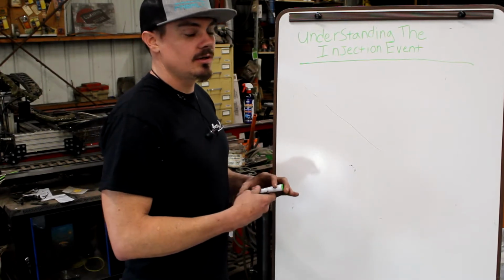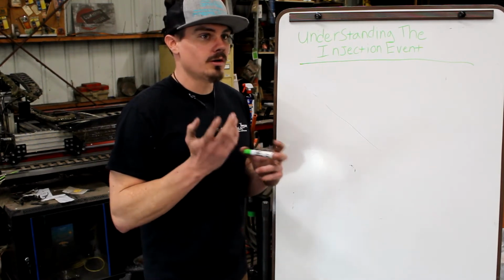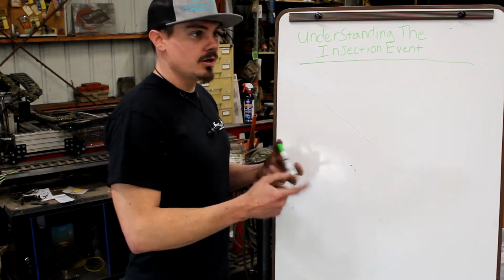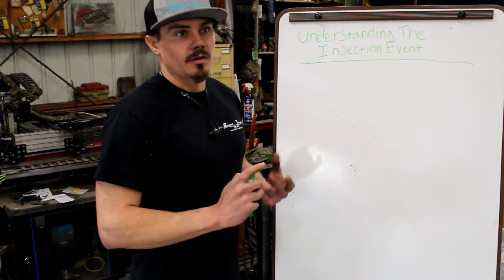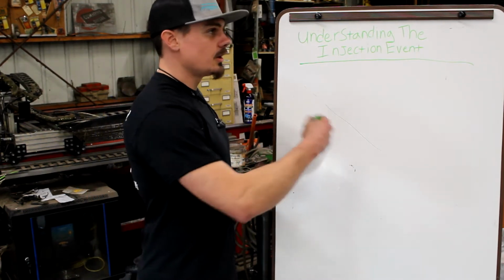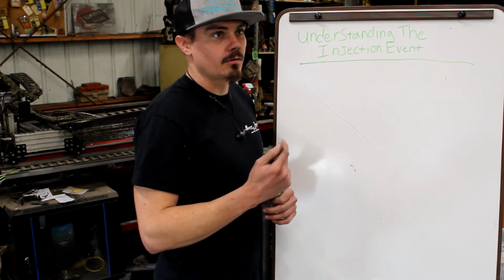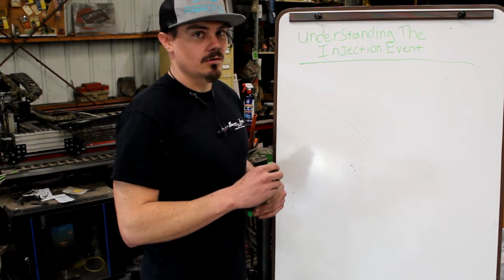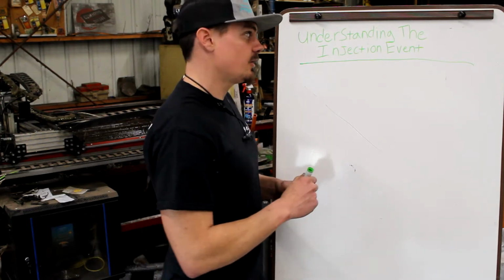And when we have high EGTs with a turbocharger and intercooling system that we know works well to a certain RPM, we've repetitively tested it not only on our dyno and in competition, but others have as well, and we get the results back from them. But when we get the one setup that someone's having trouble with, we can verify that the charger is not the issue and the engine size is not the issue, because we have all the data to back this up. Typically, it comes back around to something being up with the injector. They're either cheap injectors, second-hand injectors, third-hand injectors. All those things play a big factor.